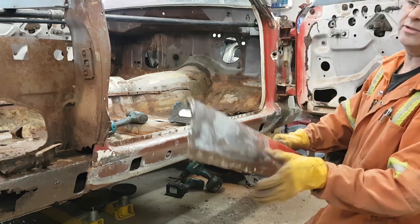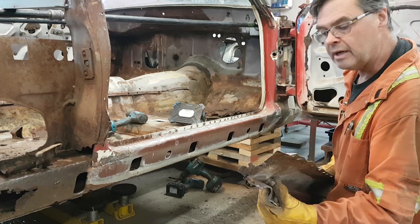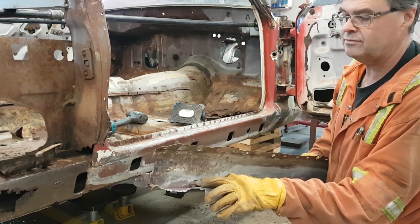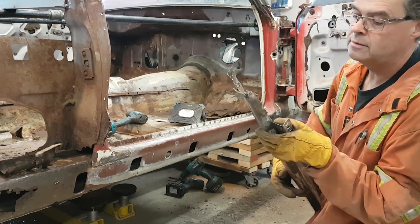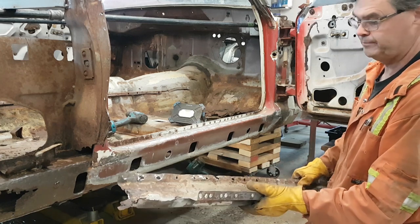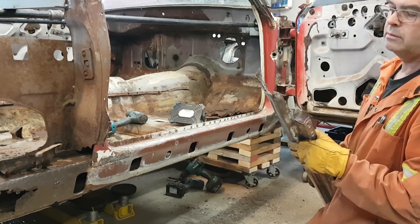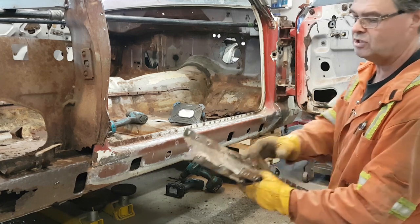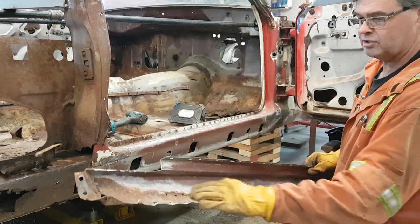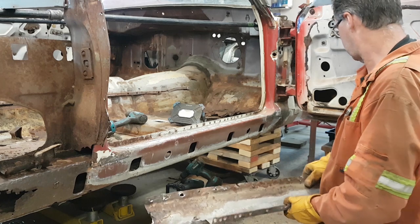There she goes. What's that rocker? Other than the flange that I pounded out, I'll just have to redo it - this is all going to be fixed anyway right here. You can see where they put lead in. Wow - it looks like that was done right from the factory. It's leaded because it's primed right over. That's a big gob. They poked a hole through and leaded it over - that would have been the factory because it's primed over. That had to have been done before they even put the rocker on the car. Anyway, there's the rocker panel - not much really to them, but this one's rusted here. The back is rusted off too.